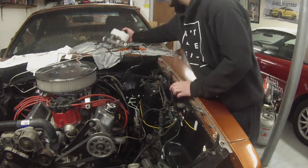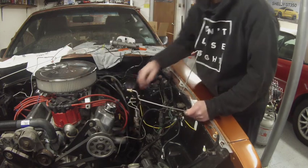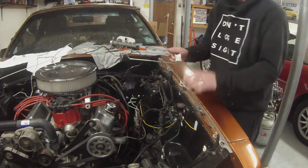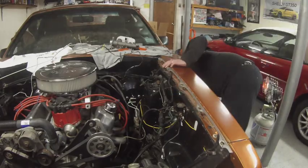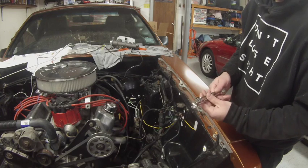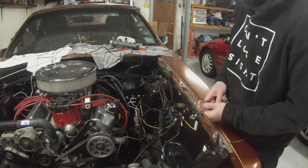So this should do the lower part here. The two front brake lines — the shorter one being the driver's side and the longer one being the passenger side — these will come and connect to the bottom of the proportioning valve. Let's get the master cylinder installed, get these two lines hooked up to it, and then worry about getting our driver and passenger side connected. And lastly I will put the fitting on the rear line — I'll probably do a double flare and get that flared up. Just a tip of general advice: these wrenches here are flare wrenches, or line wrenches, which are simply made for these flare nuts. That way you can get it on and off with the brake line — that's why it's cut — and you still get a six-sided grip so you don't strip these. These are notorious for stripping out when they get rusted on, and these are the best wrenches. You can pick these up for $10–$15 for metric and standard.